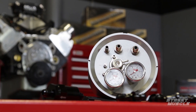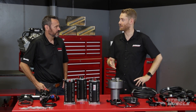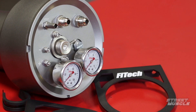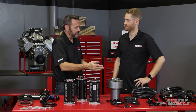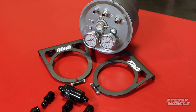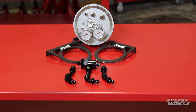The fuel command center is one of the easiest ways to go straight from carburetion to EFI. A guy with a carburetor has either an engine pump or an electric pump running low pressure — that needs to be converted to high pressure. Guys don't want to pull their tank or change fuel lines, so they take the line off the carburetor, move it over, hook it to the low-pressure inlet, the tank fills up, it pumps out high pressure, and they're done. It's mounted fairly close to the engine so there's not a ton of plumbing involved.